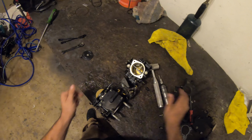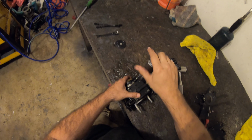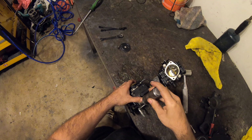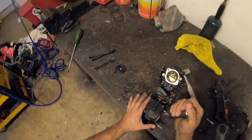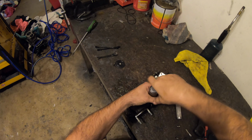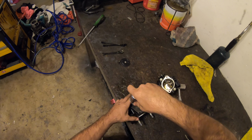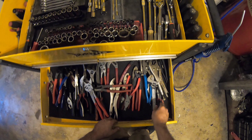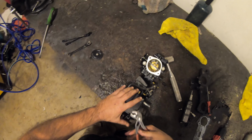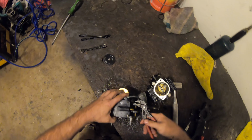It's important to get these 4 screws on the back of the fuel pump sealed tight. Otherwise, you won't build fuel pressure. A lot of times a Phillips or a flathead won't get the screws tight enough. Take a small set of pliers, put a little extra tightness on them.